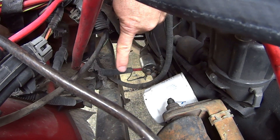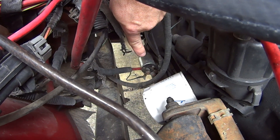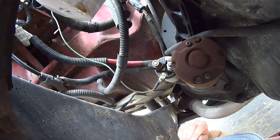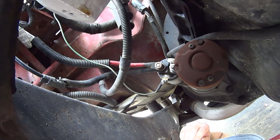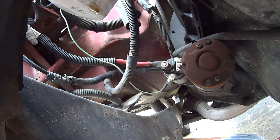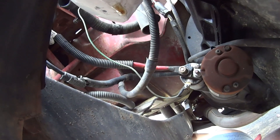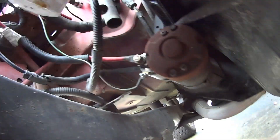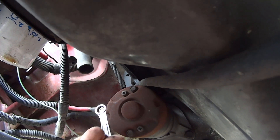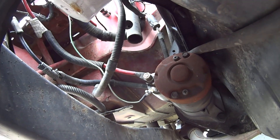See my finger right here? That's where your starter is located. The hot cable goes all the way down to the starter post right there. I'm going to get my wrench and take it right there. Remember where I pointed out where the battery cable ended up top? Right there it is. I need to reach my wrench - I grabbed the wrong size down here with me, I got a 9/16 but I need a half inch. I grabbed the wrong wrench, I'll be right back. Okay, I'm back, I got the right wrench.